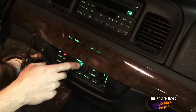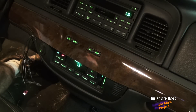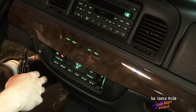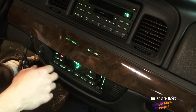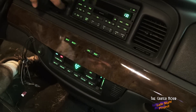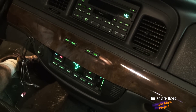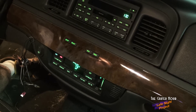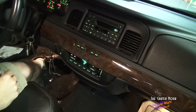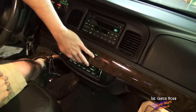So, as you can see, I have the auto climate control unit within the 2008 Mercury Grand Marquis. When I want to select normal AC, AC comes on, but there's no airflow coming out of the vents. What happens is all airflow is redirected to the defrost up here, as you can hear. So what I'm going to do is actually pull this unit out and we're going to rebuild it.